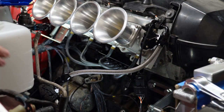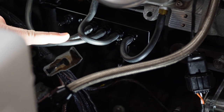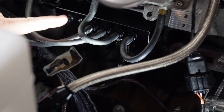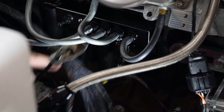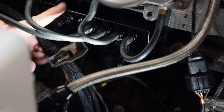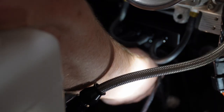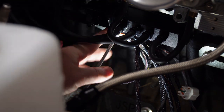I purposely left a gap between the four ports for each of the velocity stacks and then one on the end, which goes to the manifold absolute pressure sensor — I can visually see where it's at. This also gives me a point where I can tie the harness back, because the bolt hole right here used to occupy the bracket for the wiring harness. This way it gives me a nice spot for a zip tie to hang on to. And there we go — I've got the wiring harness secured to the vacuum block perfectly.